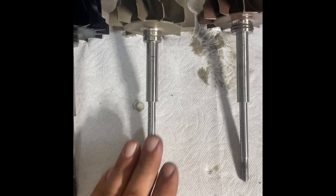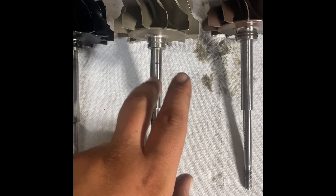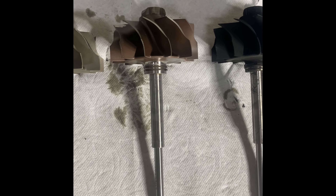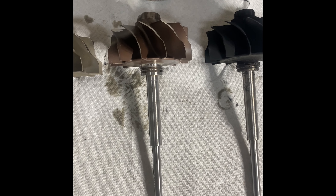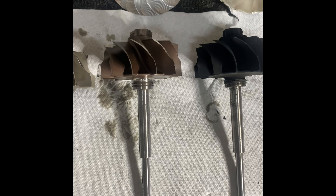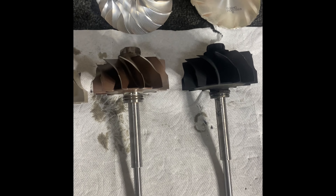Here we have the 86-72. This would be a turbine wheel out of the Pro 52 — so a 71-72 would be the spec for that unit. This here is the 77-86. This one is most common off M11 turbochargers. Those are spec 65, 77, usually 18 or 19 CM.